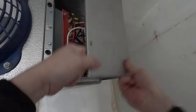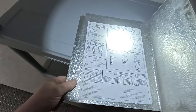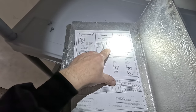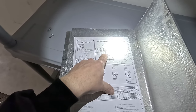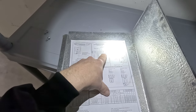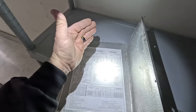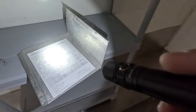We're going to get in here and see if it has one — and we do. You can see it right there. The N is red, comes in on that one, goes out on black and hooks to the F — that's your fan delay. Red is your common, brown is your termination. So red should go to N, black to the fan as your time delay, and brown is your termination. When it gets warm, it breaks the fan and terminates the defrost. As it gets colder, it delays, then makes and brings on the fan. Brown should be going to X.